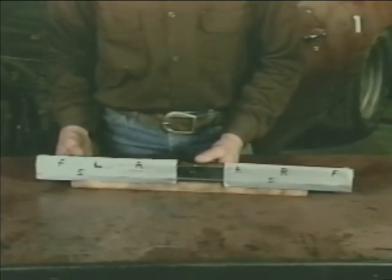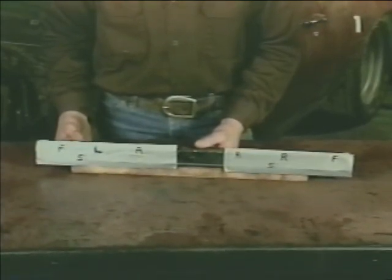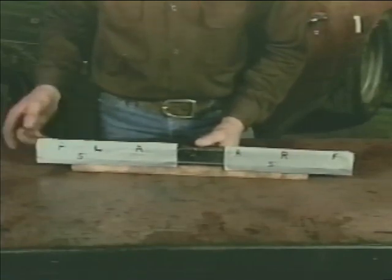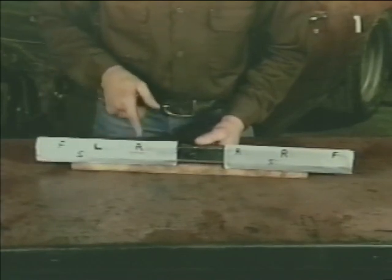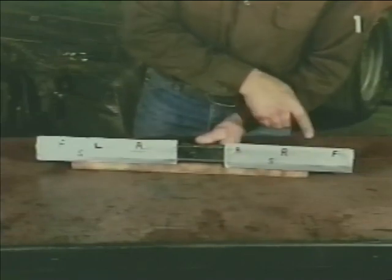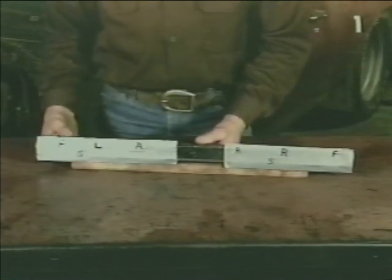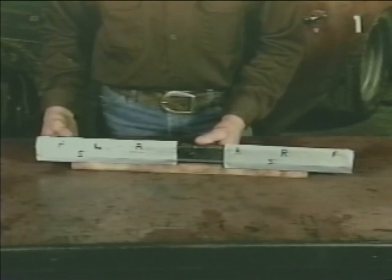This is going to be for the upper control arm components related to the shims to be redeposited back in their original location to aid in final alignment. This is where our front shims will go from the upper control arm on the left side and the rear shims. Consequently, the right upper control arm, these will be our rear and front shims. The S mark down here is going to be for the compressed length of the coil spring from that side. So when we go to reinstall the spring, we know how far to compress it to aid in proper reinstallation.